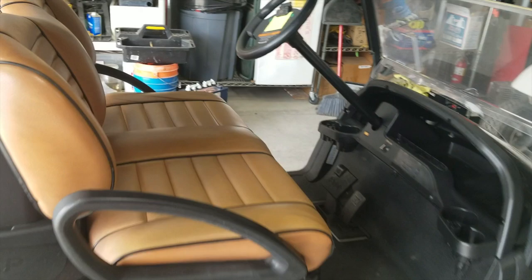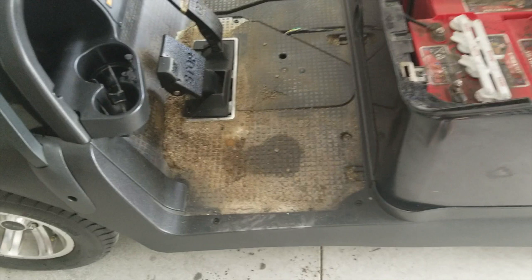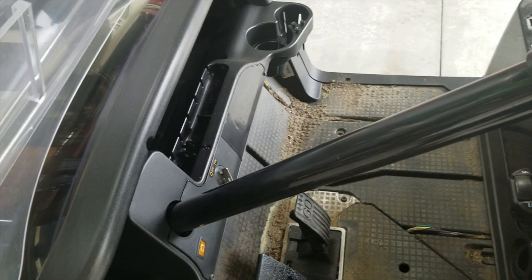First thing we're going to do is flip the run-tow switch, as always. It's in the back down here. Then I'm going to pull the seat off. To take these four screws out, if you're going to pull the floor mat up — there's two on this side, two on that side — you need a Torx T40 bit. Pull those out and then you work the floor mat up and over.